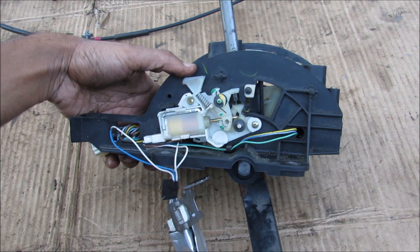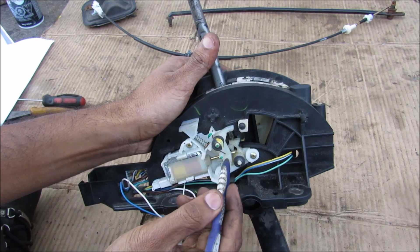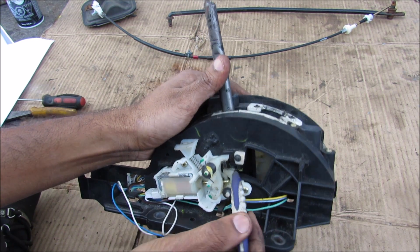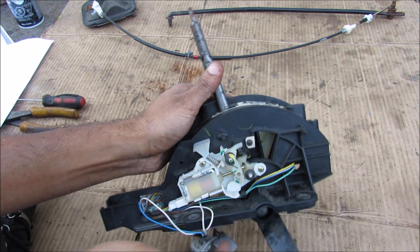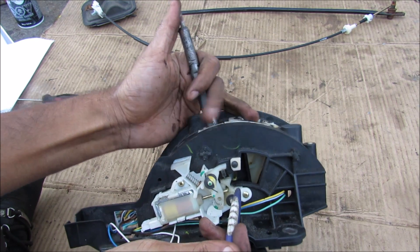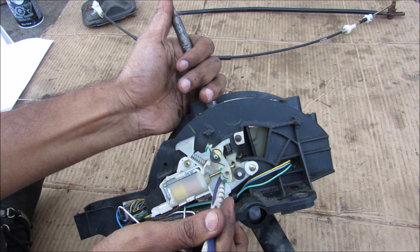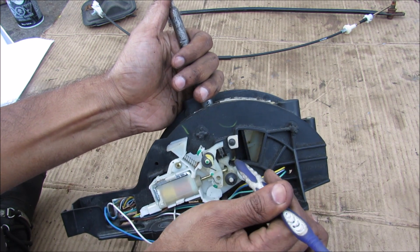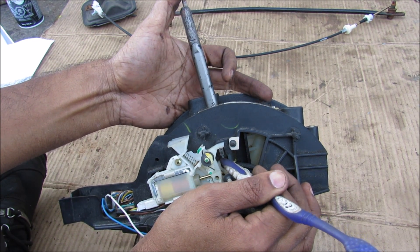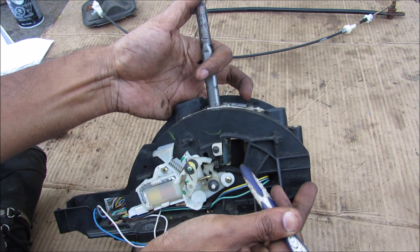If you don't have power and your battery is dead, you can use this override over here to pop it out of gear. This mechanism is pretty intricate. We have this arm in front that locks out the key, but behind it we have this little cam over here. When I push the button on the shifter, you can see it actually locks on that cam and doesn't allow me to shift. However, when this solenoid energizes, it's going to suck this little rod inward, which pulls this little cam inward — and that's going to allow this cross rod to push down out of this little detent over here and shift out of park.